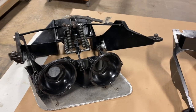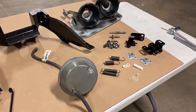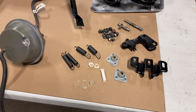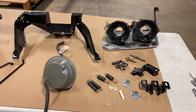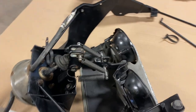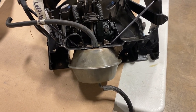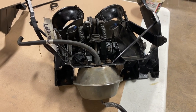We're back. I've taken the headlight assemblies apart and I ordered a rebuilt kit, though I think that was a little overboard — I actually think I could have just purchased the springs and the bushings and probably saved some money, but that's water under the bridge. I've reassembled one already so I knew what I was doing before I took the video and it all worked out pretty nicely. Both of the actuators I think were replaced by the previous owner — the boots are good and they hold a vacuum in both directions — so there's nothing really to be done with those. I'm going to reassemble everything and get these reinstalled into the car.